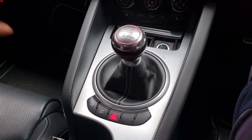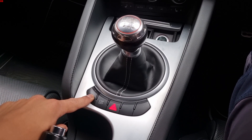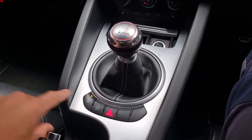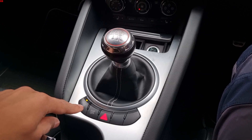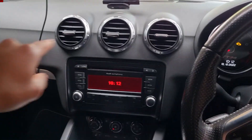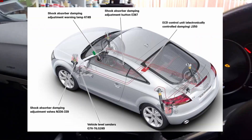Take your key, put it into your ignition, turn the ignition on, then come back to your sport button over here and press and hold it. Now you see it's flashing — it's in test mode, which has been activated. Now all four shocks will be energized, front and rear, and I'll go outside and show you that shortly.